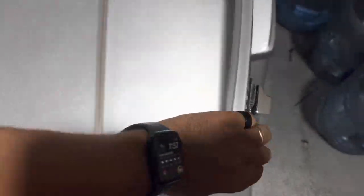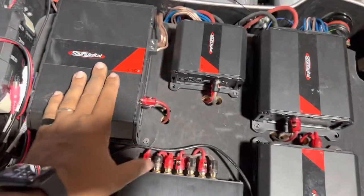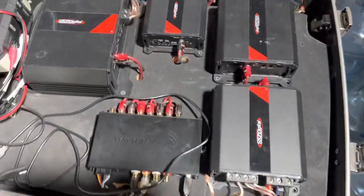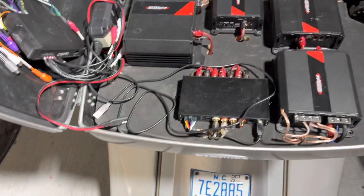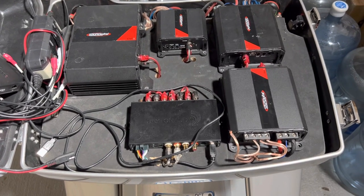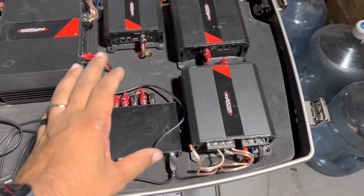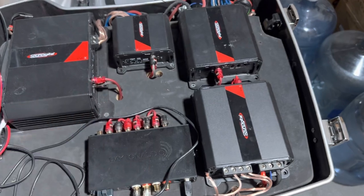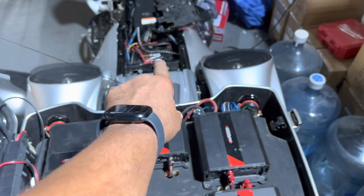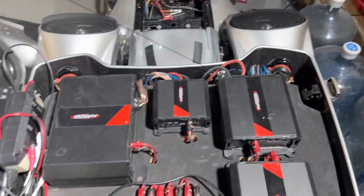So we go to the tour pack. We have a 3,000, a 400, a 1,200, a 1,200. Crazy. Wait till I lift this board and show you what's going on. We have over 5,000 watts RMS off two 8-gauge aluminum wires, 60 amps of fusing for everything.